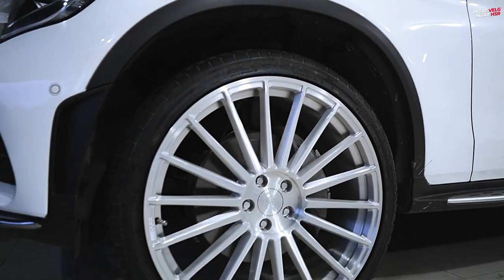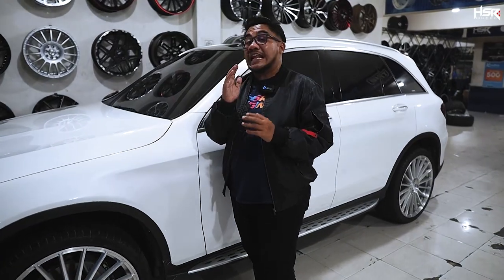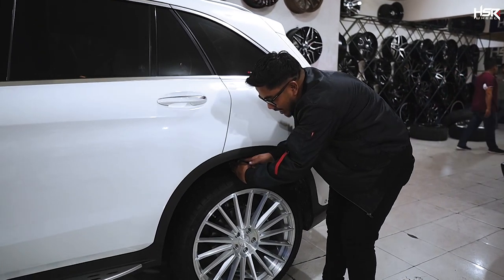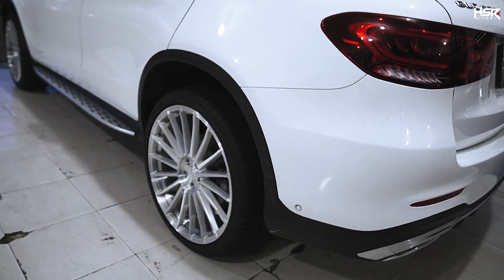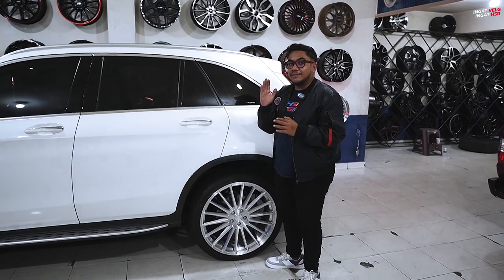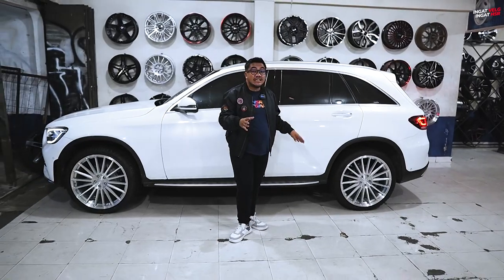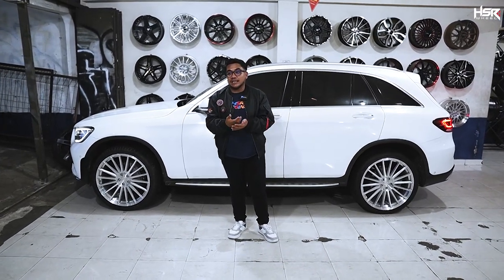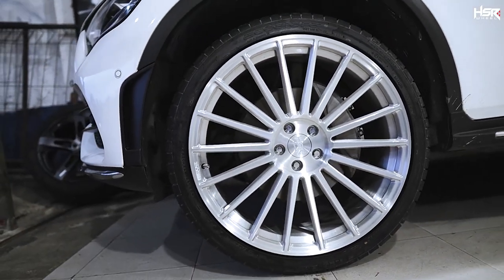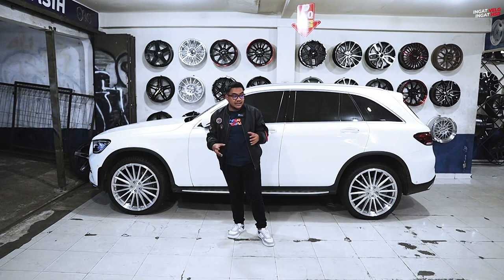For fitment, the 35-series tire is the maximum limit for Ring 22 — it's right at the edge near the shock absorber. The front gap is about 5 fingers and the fender is flush. At the rear, there's about 7 fingers of clearance with the same 265/35 sizing — more flush with the body due to same ET and width. Important note for modifying your car's wheels: at Ring 22, check for clearance near the shock absorber — there's a risk of tire contact on the inside of the fender or against the strut under compression.